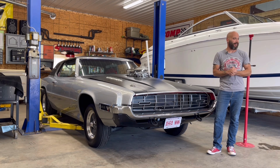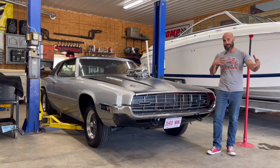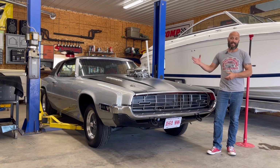waiting for Mad Dog Kenny to get here. All we got left to do on this thing before we can really go to the drag strip and test it out is we need to get those control arms adjusted so everything's right with the world, true, straight, you name it. We also got to set that pinion angle. From there, we're going to check to make sure nothing's leaking, do a once over on the car, and pretty much call it good. I'm pretty excited to see how this new combo is going to work at the drag strip. That's obviously going to be weather permitting.